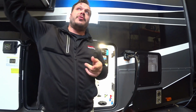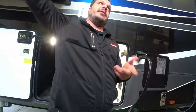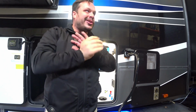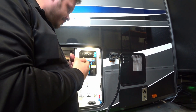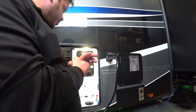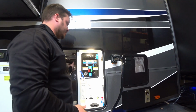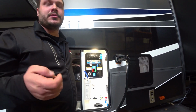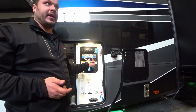Now, the other option you do have, you have Dish Network, right? You have Wally boxes? Okay, so that means they are able to go anywhere. So I believe there's a way you could probably split it. You could put your boxes out here, and since they're RF remotes and not IR remotes, you could split the signal from the box and get it everywhere.